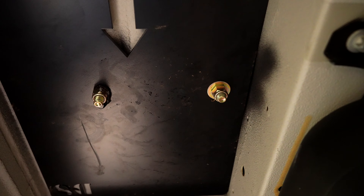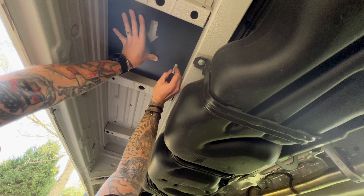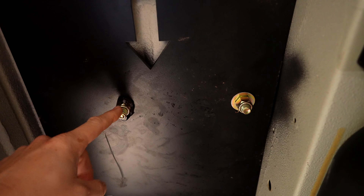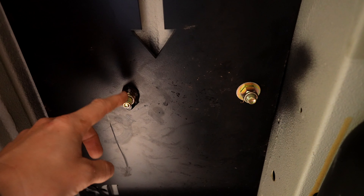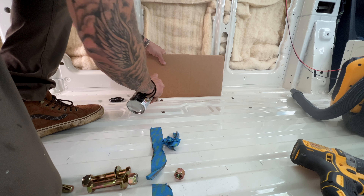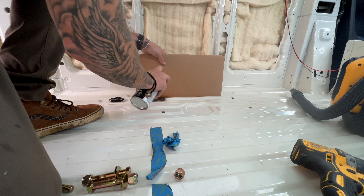I'm going to go underneath and show you exactly how we installed it underneath the van and how we drilled the holes. Very simply, here's your arrow — this arrow points towards the front of the vehicle. You have two holes: one on your left, one on your right. The one on the right is the short side; it goes towards the gas tank. The bigger plate goes up front, the smaller plate goes in the rear, and it has the same concept. One bolt here, your offset bolt on the short side goes towards your gas tank. Arrow faces the front of the vehicle. This plate is cut specifically to pinch the welds all the way around everything you have here.